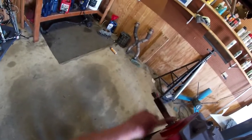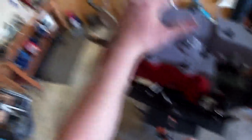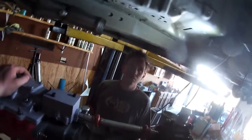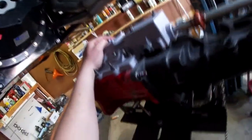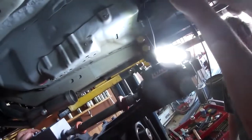When you're doing these transmissions, you don't have to lube the shaft because the throw-out bearing is actually not riding on it. But I still put lube on the very tip of it because that's going to go into your pilot bearing. Let's see if I can actually get this in with the crossmember and the driveshaft loop in. I pushed it back as far as I could so hopefully I won't have to pull that if I've got to pull the transmission or the clutch on a track day.